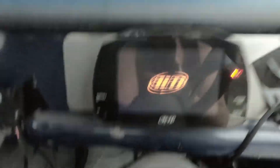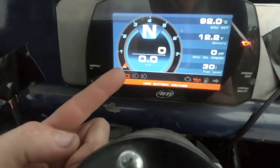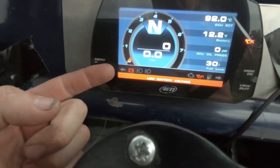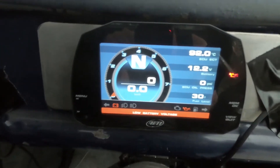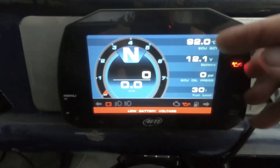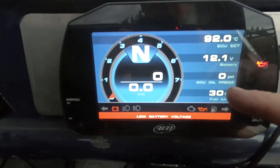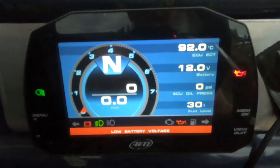This thing's airbagged — you can hear the airbags working. Fire it up, powers up. So I've got the screen here. We've got a battery light, so that does excite the alternator correctly. Oil light and an extra warning oil light. These icons I can change around to suit. Having indicators that flash nicely — that's all programmed in. We've got proper readout so I can put whatever I want in the readout and configure different screens. There's a fuel warning that comes on at 10 litres; you can see it's actually got 30 litres of fuel in this vehicle. All the normal stuff — high beam, low beam.